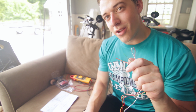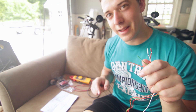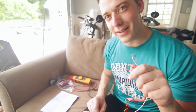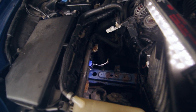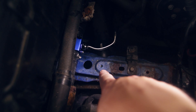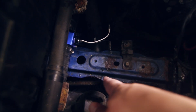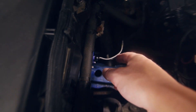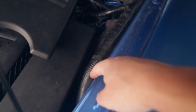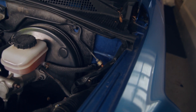Now we've got to get under the dash with our voltmeter, test which wires are getting power when, and figure out what wires to cut and splice into. While it's still nice out I'm going to finish the engine bay wires first. I'll connect a wire from the sensor's black wire and ground it to that bolt, then connect the sensor's white wire to one of my black wires and run it up through here, around the side, and then through that grommet down there, past the firewall and into the inside of the car.